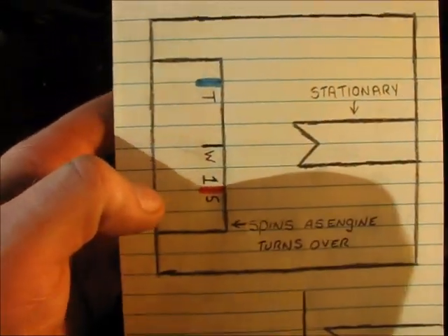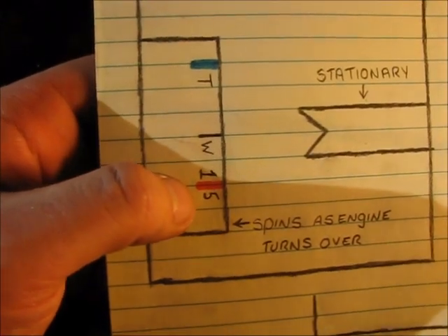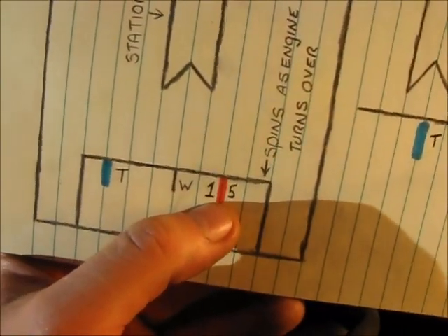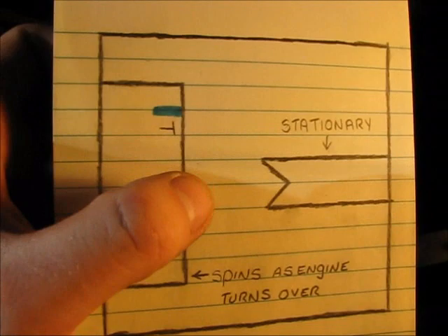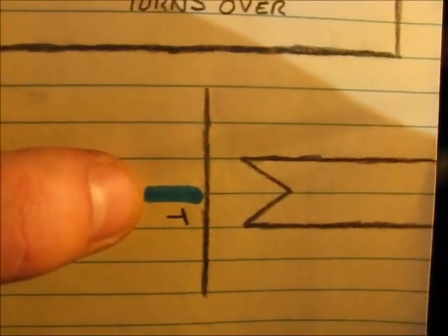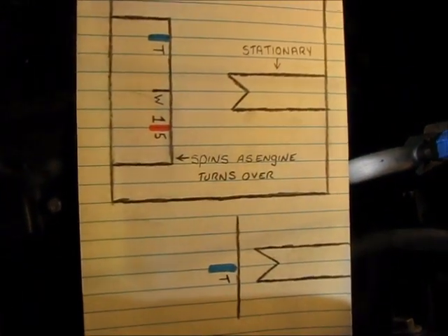This is doing it when the car is off, cranking the engine by hand. If you have a timing light, you'd be looking for the red mark — fifteen degrees before top dead center. We're going by the white mark with the letter T. When that's in the middle of the notch, that is top dead center. The straw method and the distributor check only get us close; the timing mark access point is positively knowing when you've reached top dead center.